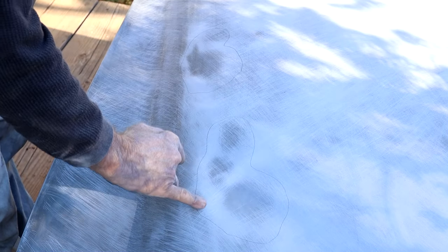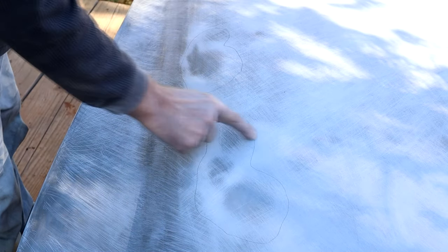The reason we pencil this out is because I know that this area out here is all good, so we can restrict our filler to just this one area. We're going to go just past the pencil line, and when we sand, the pencil line will show itself and we can restrict our filler. I've seen it and it never seemed to make sense to me - putting filler all over the whole panel and having a load more sanding to do. So we know these are our low spots. We do have to scuff up these low spots because filler won't attach properly to guide coat, so I'll get a little scrap piece and make sure that's thoroughly cleaned off.